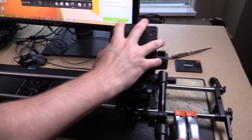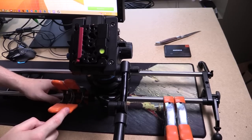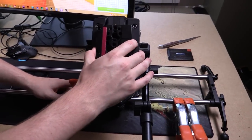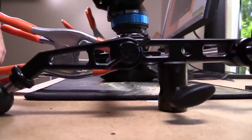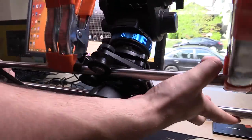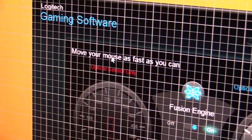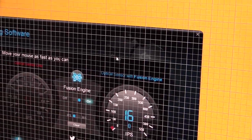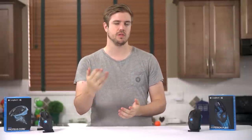So to calm my anxiety, we tested the G402 sensors by grabbing our camera slider and doing a few modifications. I replaced the traditional soft stopper method with dual heavy duty clamps to reduce travel when the slider bumped into them. I then put the slider on the table and lowered it as far as it could go, using a Velcro strip to secure the mouse to the bottom of the slider. Then for measurement, I put a grid overlay on my monitor. After all this setup, I tested it with a variety of movements and I'm happy to say that as far as I can tell, the G402 features what is known as a perfect sensor with no inherent acceleration. Kudos, Logitech.